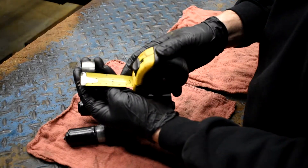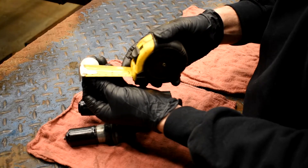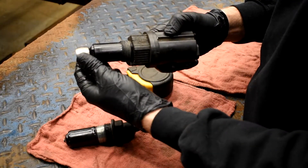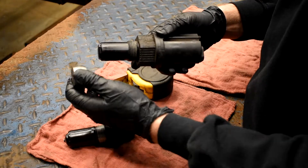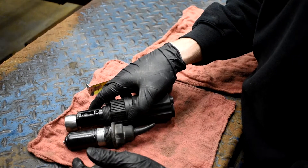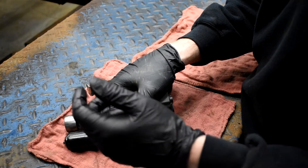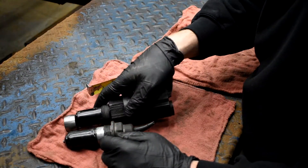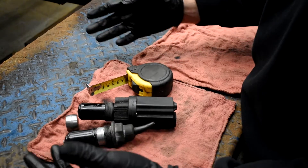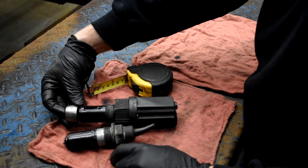The spacer is about three-quarters of an inch long and about one and three-sixteenths wide. This piece goes right against here — you put it in the differential and it goes right against here. When the actuator extends out, it will give you that extra throw that the newer actuator achieves for those 97 and under front differentials. So you can adapt an older differential into a newer truck, or if you have an older truck and want a newer shift actuator, you can adapt it into your older axle. In this case, we're using it to get the older axle to work in a newer truck.